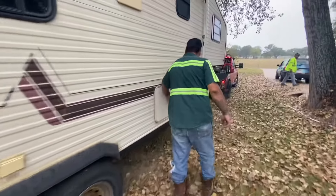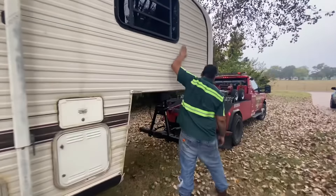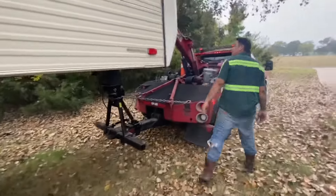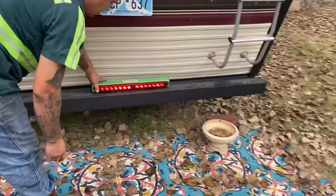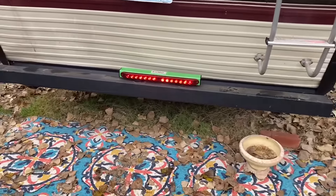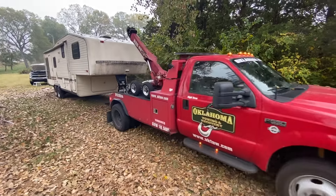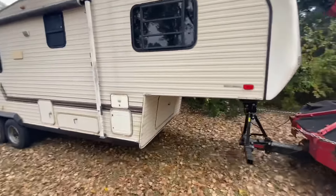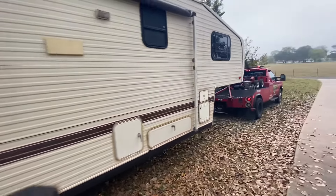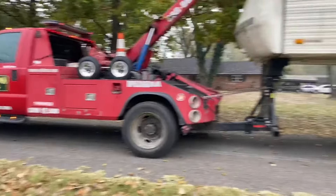It should be pretty smooth sailing after that. Be careful — watch your length and pay attention to your clearance, because low trees and things like that will scratch the top of the trailer. Make sure your lighting equipment works. If the trailer's been sitting for quite some time, it's always a good idea to get it out to road level and check again to make sure everything's secure and the vehicle is level to your liking before you get underway. It's always a good idea to check everything twice. Thanks for watching.